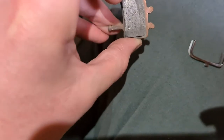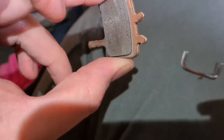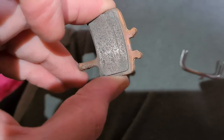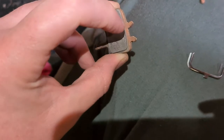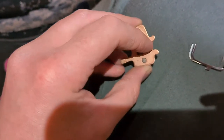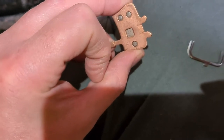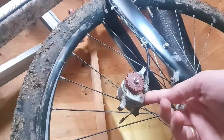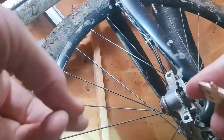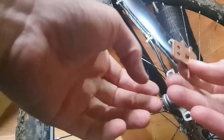There's a bit of a problem. The new pad versus the old pad — the new pads are ever so slightly bigger than the old ones and they just will not clip into the caliper. So I'm going to have to take a file to the new ones and just take a bit of material off the inside of the tab there, just a tiny bit, because it just will not pop in. Here we go. So here's the tabs now — I'm going to have just filed off the inside of both of those because it just would not fit.